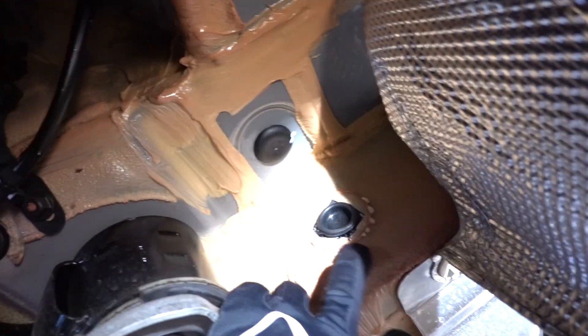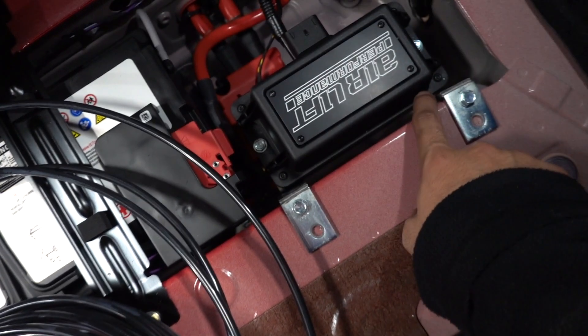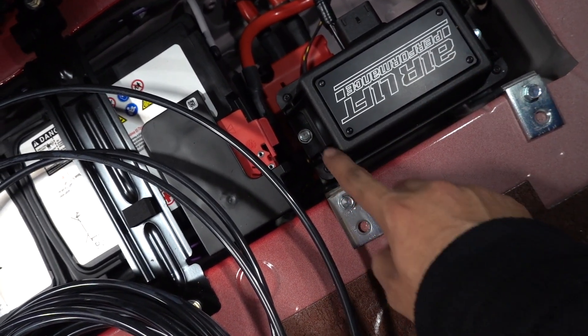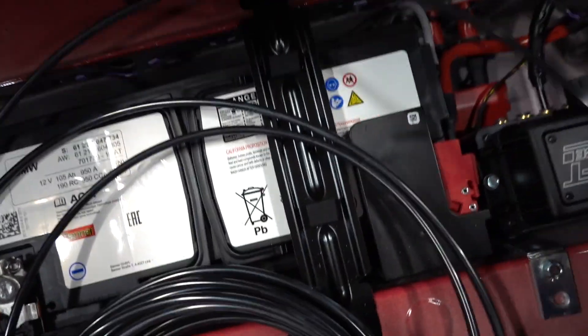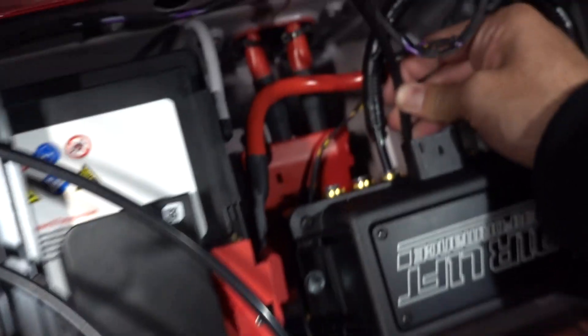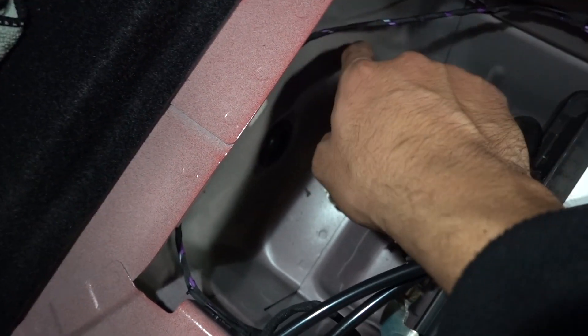There was actually a plastic grommet here that you have to break off. I installed a rubber grommet I bought and poked a hole in it so we can run the airline from here to the back of the air spring. I mounted the manifold — where all the lines go — using an L bracket bolted onto the car's metal. We're going to plug a line into the rear left port and run it all the way around the battery, out through the grommet, to the back of the air spring underneath the car.